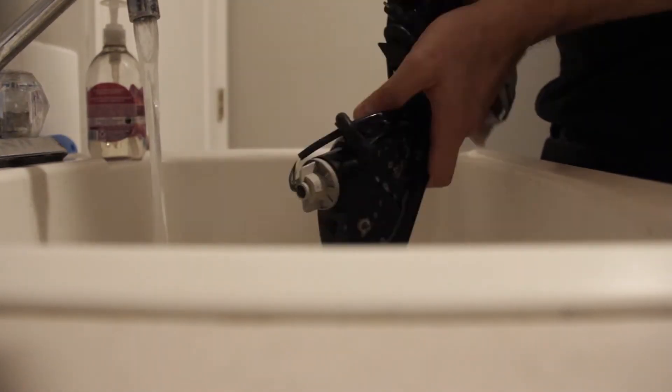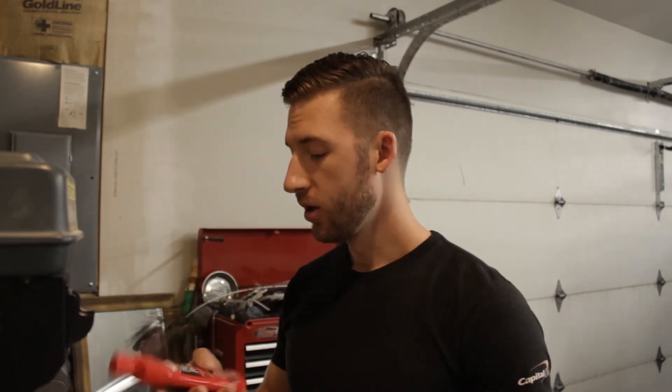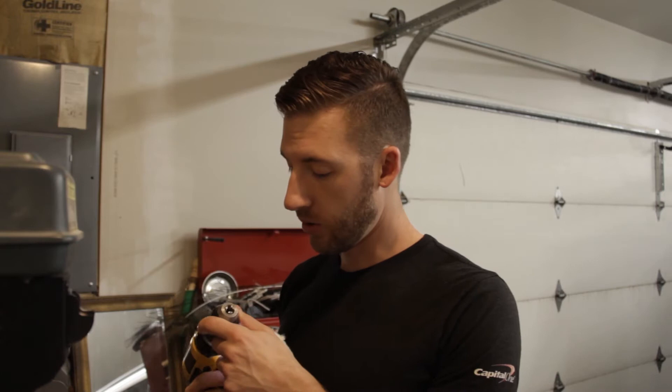So man, I really appreciate it and these are going to look awesome. So let's get to it. All nice and clean, ready for polishing because they can still look a lot better. I'm going to be using a buffing wheel, and I always use Mother's plastic polish. There's a ton of stuff on the market, but I've always used this and found it works really well on clear things like lenses, as well as gloss black or solid colored trim. You can basically use any kind of rotary tool — I always end up going with a drill because it's a little easier and a lot lower speed than a die grinder.